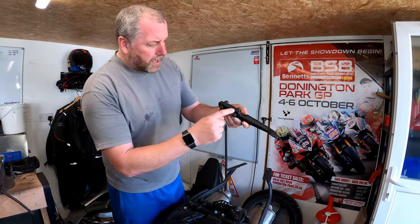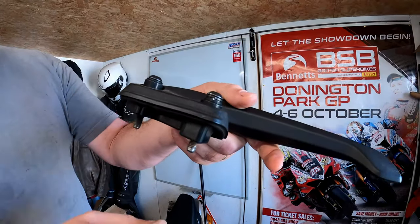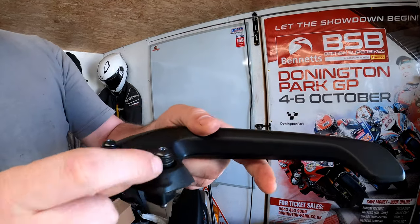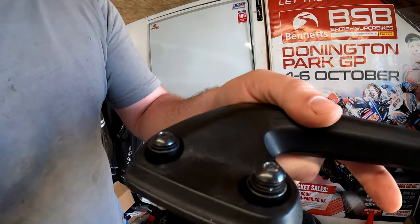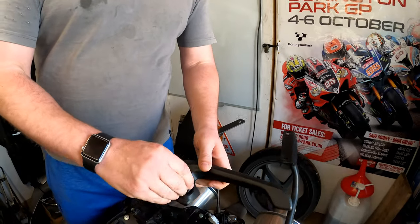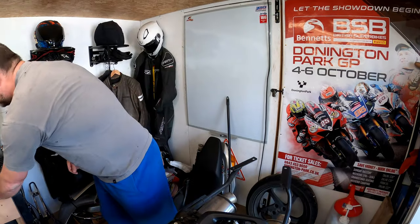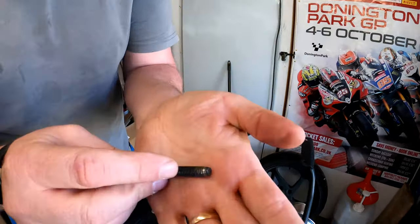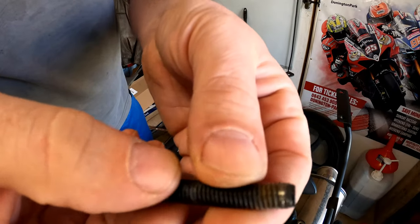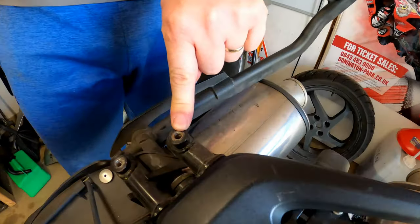If you look, you can see that a previous owner has put a stack of washers underneath the bolt head on this one. It should be like that - should be this little spacer, then a washer, then the bolt head - but for some reason this one had a load of washers on, and you can see at some point someone's had to get some grips or something onto it to get it off, and it's looking pretty poor anyway. If I pull the bolt out and have a look at it, you can see that it's actually absolutely screwed - but yeah, that bolt is knackered, and consequently the thread inside here is knackered as well.